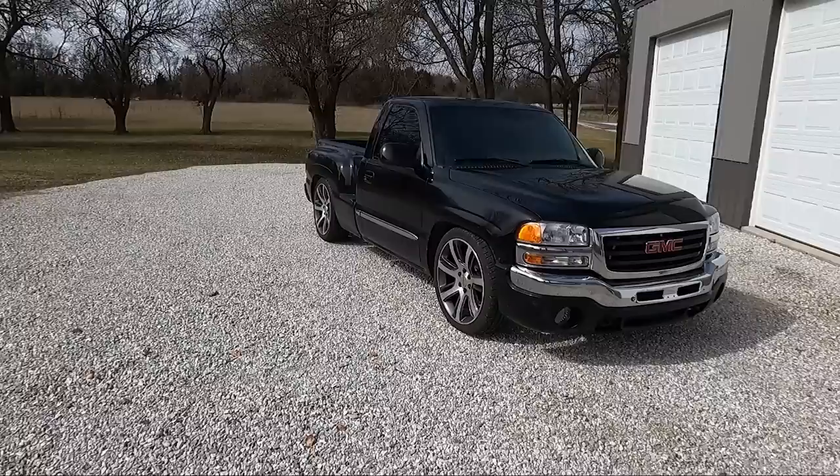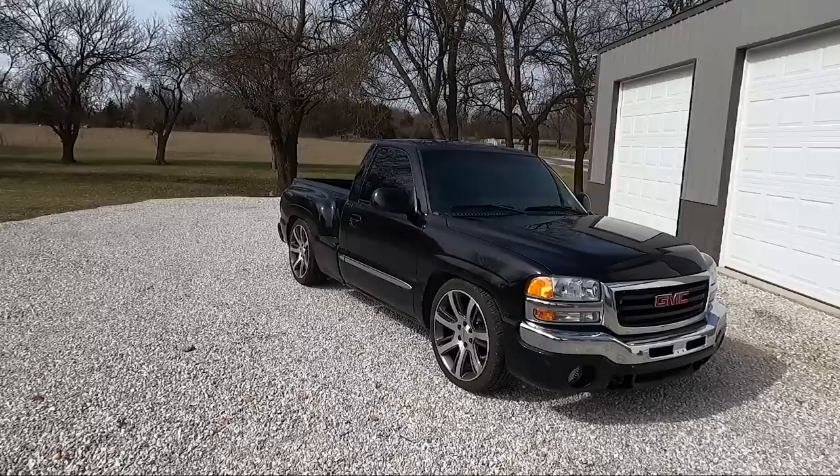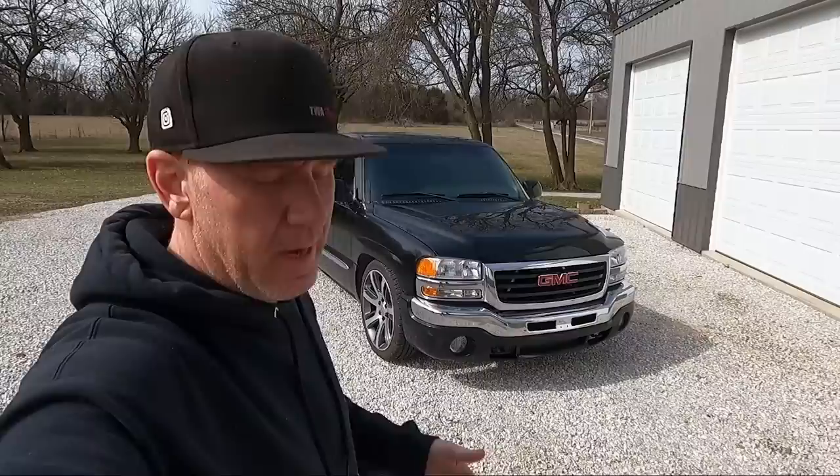As you can see, we did not go as fast — we actually went slower with the intake on and the electric fans. The temperature is a little different, it's actually a little cooler. It did spin. This has been a couple of weeks since I did the last thing, and my son was with me this time — so an extra 125 to 130 pounds, that's at least a tenth. We also put a tailgate on, which adds a little drag on the back, and we didn't have a tailgate on the first time. So ultimately we probably ran about the same.